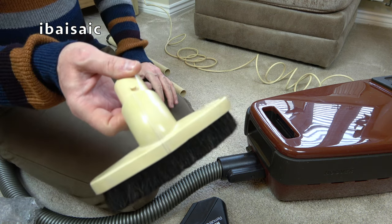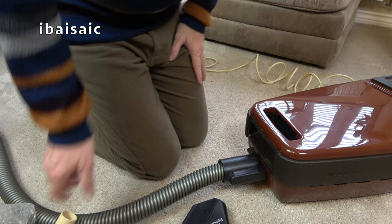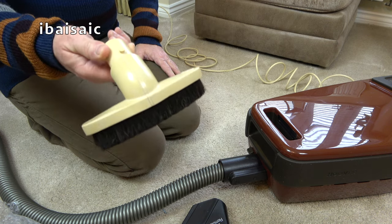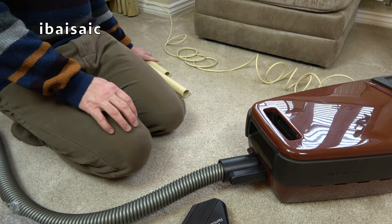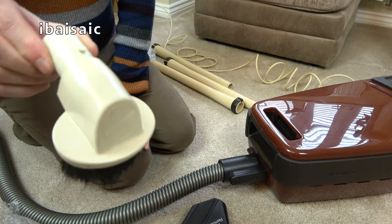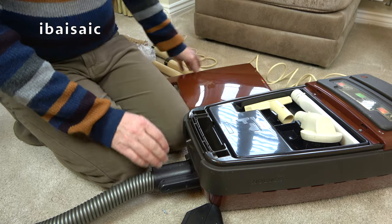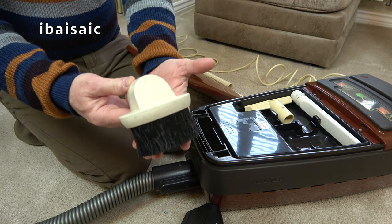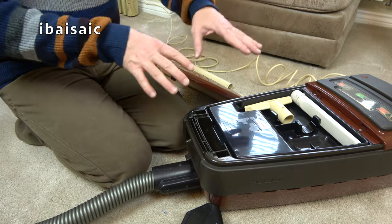I think that extension tube is cream. The all-purpose brush from the listing is a UK-made brush, not suitable for this machine - it goes in the spares box. That white/discoloured one isn't suitable either. The Sensortronic dusting brush was a much sleeker, flatter design so it would fit in the tool caddy. I should be able to get something more suitable. The machine body itself seems better, so I'll just take the tool caddy and tools from my other System 3.